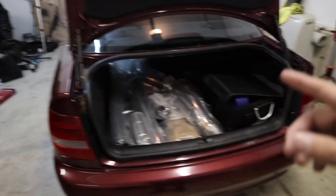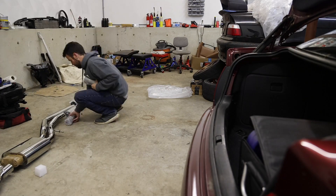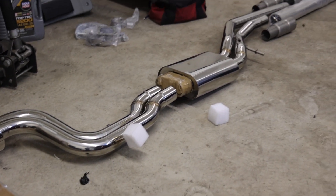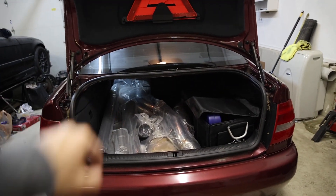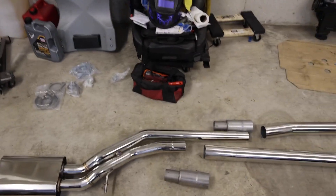This is actually the dual muffler exhaust, the Twin 2 from Excess Power — three inch downpipes to two and a half inch catback with two mufflers. Fingers crossed we can make it work. We've got to get this thing jacked up in the air and cut this old exhaust off, because the previous owner welded it all together. The flex pipes are on their way out. We're going to do the whole thing fresh, ready for a big tune. And eventually down the road we might do a single turbo — there's an intake manifold back there prepared for one. I'm actually not upset about the two-and-a-half inch catback; it'll just bolt up with a clamp and we don't have to do any welding.